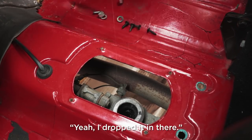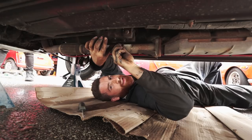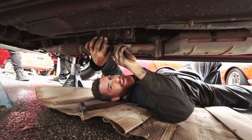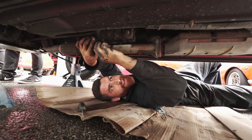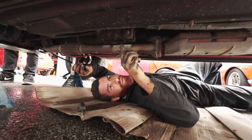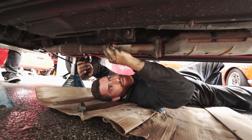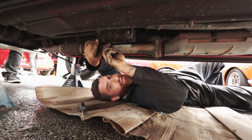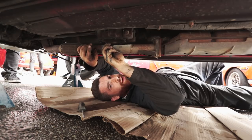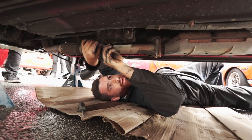One eternity later — despite putting the shop towel in the top of the housing, I only caught one of the roll pins. If this happens to you, you'll need to take off six Phillips head screws on the bottom plate; that plate comes off and then you can retrieve your lost roll pin. You definitely don't want to leave it in there, because if it moves around and blocks up the shifter one day, that will not be good news.